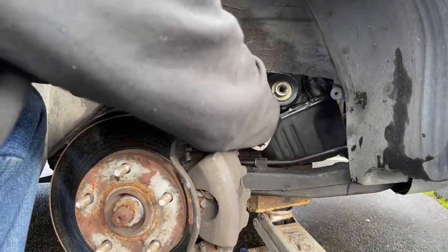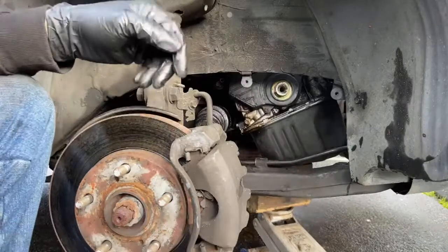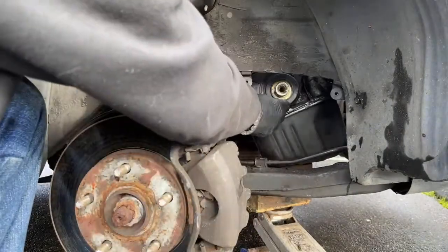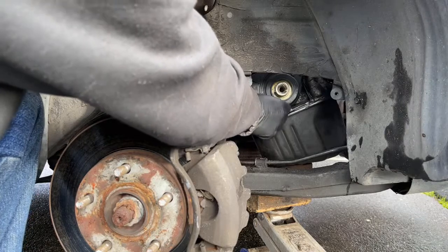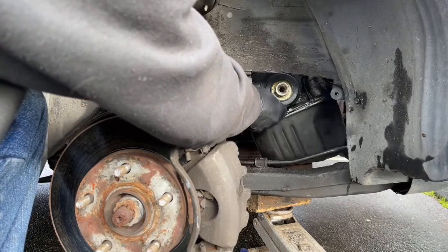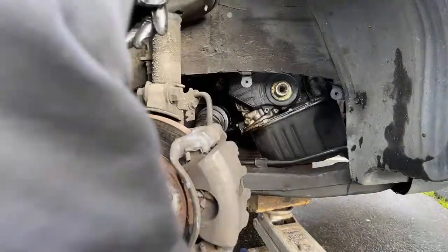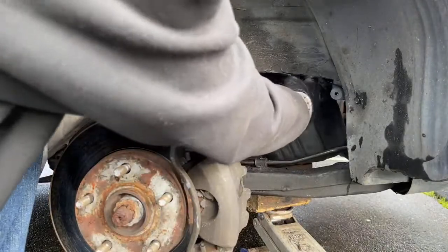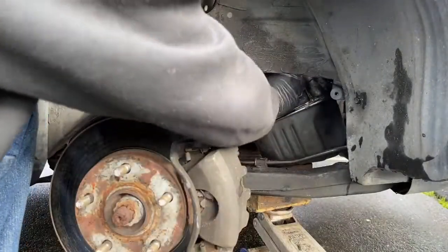So there's a leak? Yeah, I'm trying to figure out where this oil leak's coming from, because I had the timing belt off. I did a new timing belt on it, and I replaced what I saw was leaking, which was the cam seal and the crankshaft seal. But it's still leaking just as much as it was. So, get to this point.